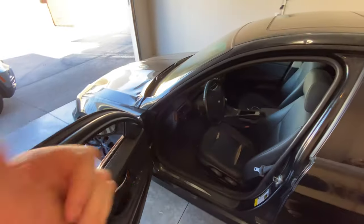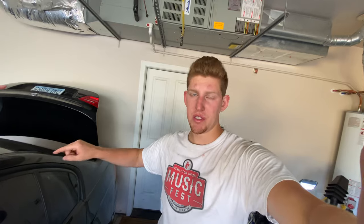My purpose of this build is that I just want to clean this car up, get it back on the road, and make a little bit of money in the process. I bought this car as a non-running BMW that just cranks but won't start. Pretty sure it's the fuel pump. I cranked it, I pulled the rear seat, and there was no activation of the fuel pump, so I'm going to check the fuse real quick and then we'll dive into it.